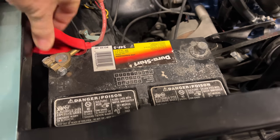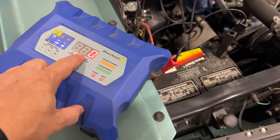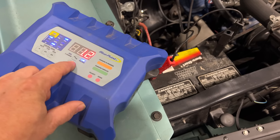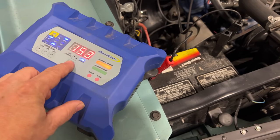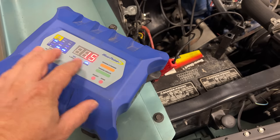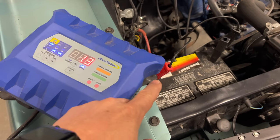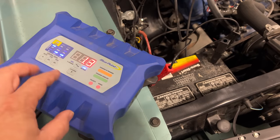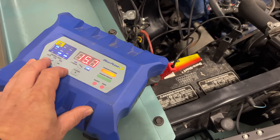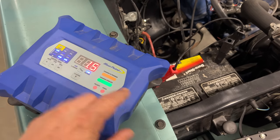Looks like the battery was left unhooked, so let's hook up my charger to it and see if it has any voltage. The charger shows it's charged at zero percent, only 1.2 volts. The charger kicked off right away. Even at low current it's not able to charge this battery. When you store a battery uncharged and let it go through winters, it does a lot of damage internally. So I'll need to go get a new one.